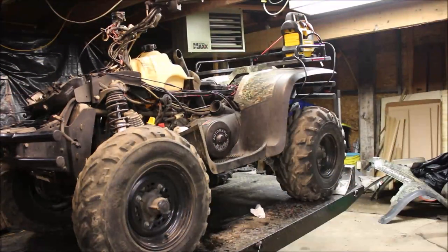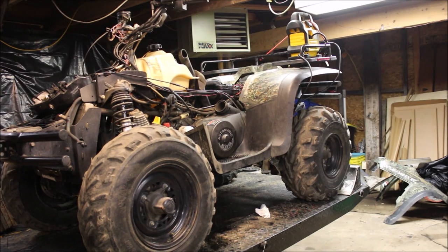So, all right, fast forward 2 hours later. I did have to torque the jug bolts down because the guy didn't have that torque correctly. Got everything all back together. Did the torquing sequence for the head. Got everything all put back together nice. Go to fire it up and it kind of ran funny. So I ended up taking the carb apart. I found some dirt in the jet. Got her all back together.